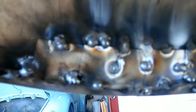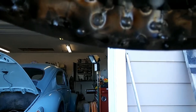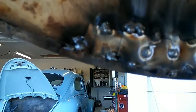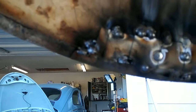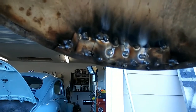The progress isn't pretty, but it is welded in. I can see the other side — all the paint's gone and the weld is going all the way through, so we have penetration, no problem. This is super strong now. What you need to do is grind all the welds down nice and neat, and if you want it to look perfect, just put a coat of bondo over it. You can also just weld up the cracks, but they'll crack again — that's the original poor design, which is why you need to put a support in.